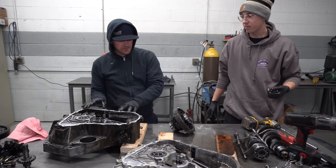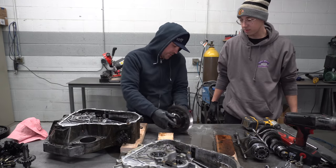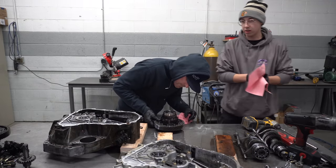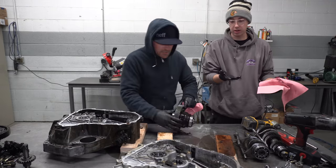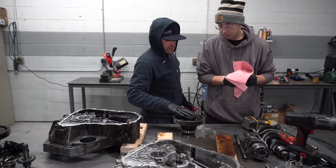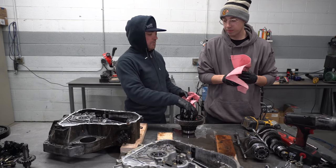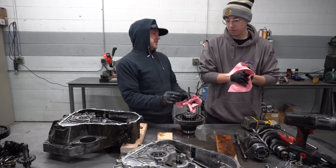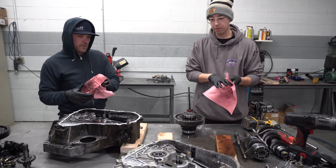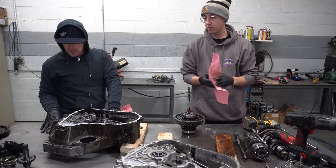I'm sure it was that axle, and this trans was fine — that axle and this trans was kicking out, correct. There's no way for me to tell honestly; you're just going to have to put it in and if it's bad I'll take it back apart. It's not common — usually it's the wrong size axle or something like that. I probably didn't shim it at all. It doesn't matter; that wouldn't affect where the diff sits. What you're doing when you're shimming is you're shimming the distance between the trans case and the bearing, which has no relation to the axle popping out — unless the shim was like a half inch, but we're talking thousandths of an inch. We can check the shim and switch it if needed. So this is the LS tranny — all LS stuff — and this is the GSR.